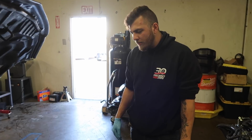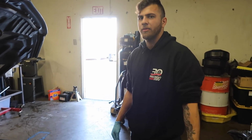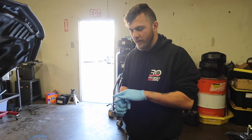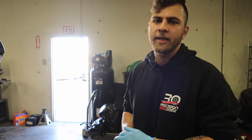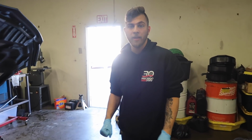The only problem with that high of a torque is it crushes literally where the stud goes on the cylinder head. There's a little recessed area that the washer sits on. It usually crushes that, and you can actually crack it. So that's why people go to 1/2-inch studs, because you don't have to apply as much torque, and it'll actually hold that thing in place.